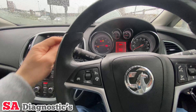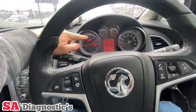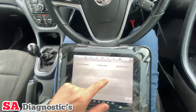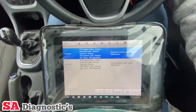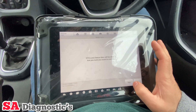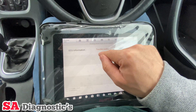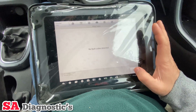That has now relearned it and knocked off the light. The remaining one is to do with an ABS sensor as far as I know. We'll come back out of this — turn the ignition off, turn the ignition on — and now we should have no faults left. There we are, nothing's there anymore.